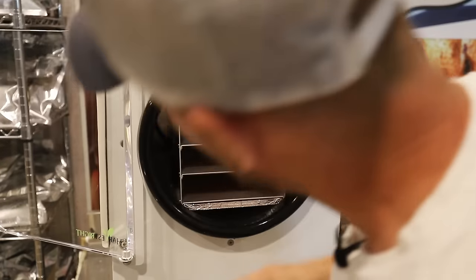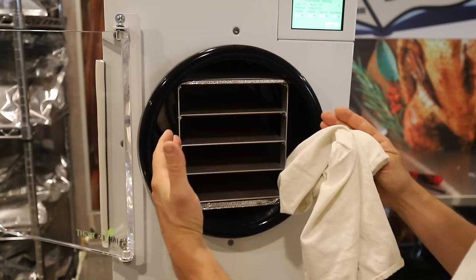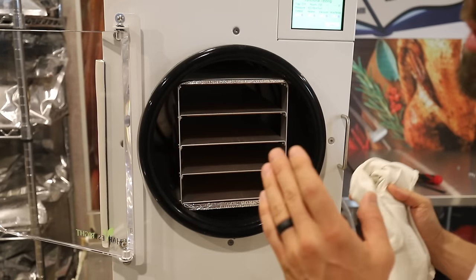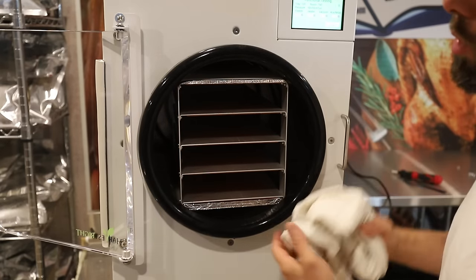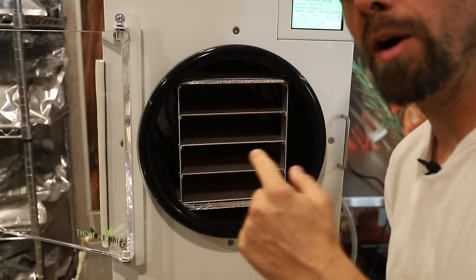There's four that you can actually take the chamber and slightly tighten it up or loosen it up if you need to. Don't over tighten. Also, do not over loosen, if that's even a word. Really what you're trying to do is make this so it sits as flush as possible. If that does not work, it could very well be your door. That's a very common problem.